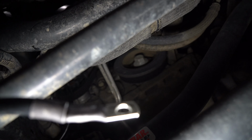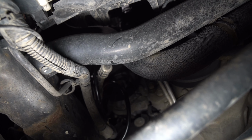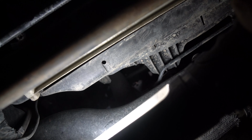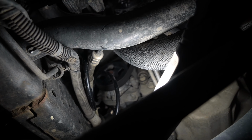Up there is where it's coming from. Now you're gonna see that pulley. Well, we don't want to go anywhere near that. So if you look, there's two pipes right there that come down to that loom. Very hard to show you, but you'll see my wire there coming down from inside. Let's see if I can get you a better view. Basically, see that pulley right there? Make sure you zap strap this wire away from that pulley.